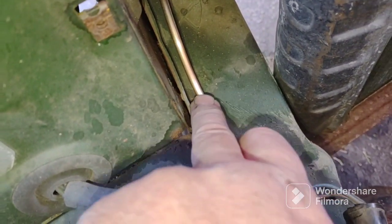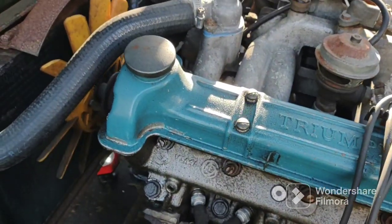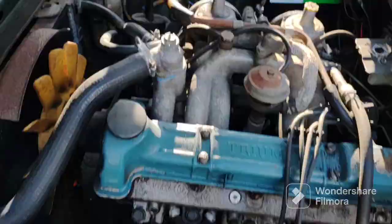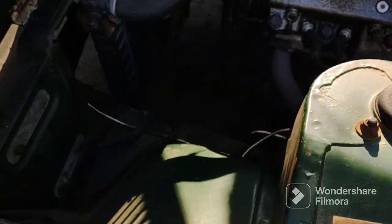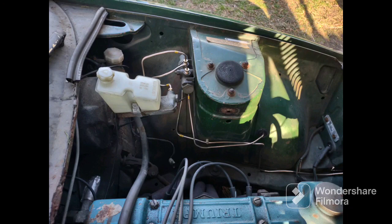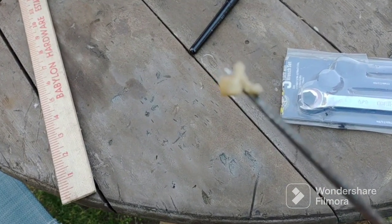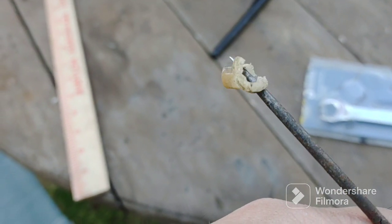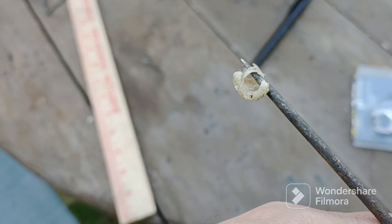Making progress. I just hit the last clip, and then there's going to be a bend coming up and then over to the clip on the top of the sill underneath the slope part of the car. The line is just hanging out over here — should be okay. This was the final clip on the passenger side. I should have known because there were the same ones on the other side. Lines are all connected. I just have to pop the passenger side front line into the clips — I just need to go in the house and get one more clip.